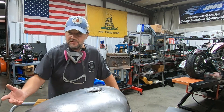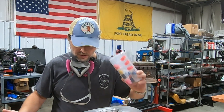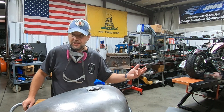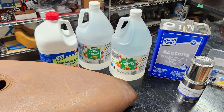The first thing I did with this tank — as you can see it was completely rusted out on the inside and out. Where I like to start is with a vinegar bath. You can order these little silicone or rubber plugs cheap from virtually anywhere. Seal up all the holes, fill the tank with vinegar and a handful of sheetrock screws — count the screws when you put them in. Let it soak for upwards of 45 minutes to an hour, agitating and flipping the tank every few minutes to loosen scale and rust. Then drain the tank entirely, remove all the screws, and give it a good rinse.